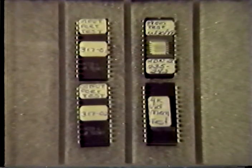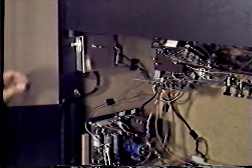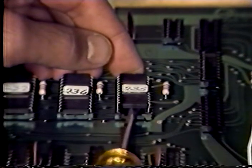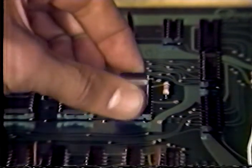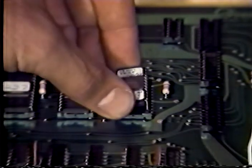We'd like to demonstrate a new set of game test EPROMs, which will be available through your distributor soon. If a game should quit working, these test chips could get it back into order, usually right on location. First, turn off the game using the safety interlock switch on the back. Then, after removing the first game PROM, plug in the test PROM you desire in that socket. Here we are demonstrating the output test PROM.